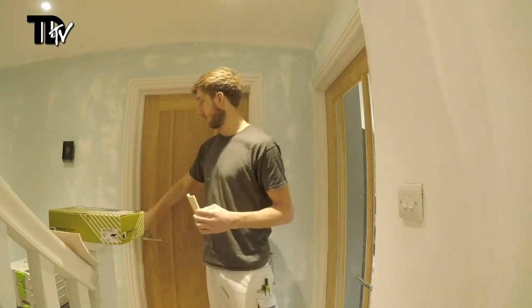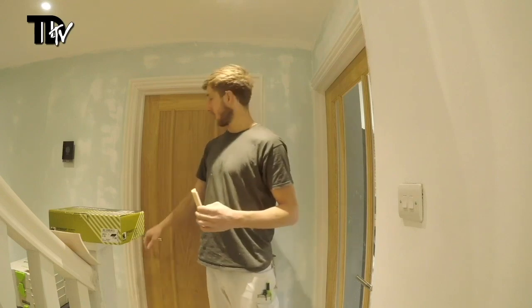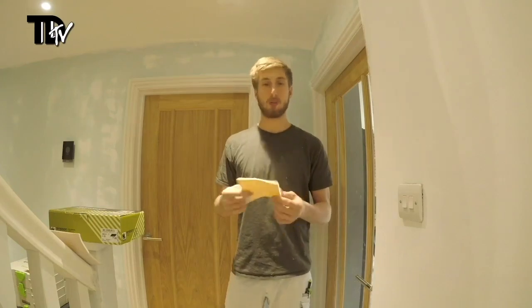I'm going to show you a little video now of me sanding down this section of door frame — just bringing the camera closer so you can see how well it molds to the profile. Showing you now how well the Indasa Rhinosoft pads contour around this door frame. I'm currently de-nibbing this using 240 grit and it goes around all of the curved sections really well.